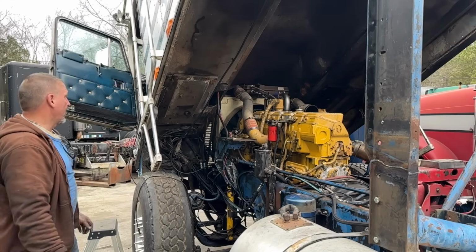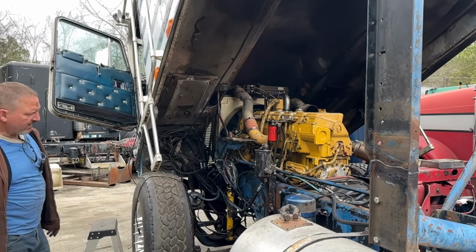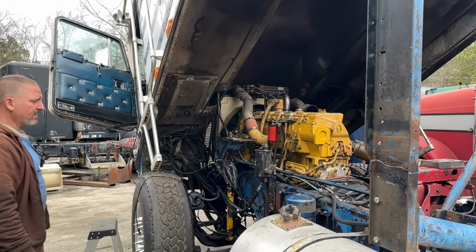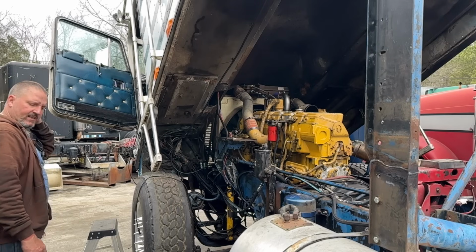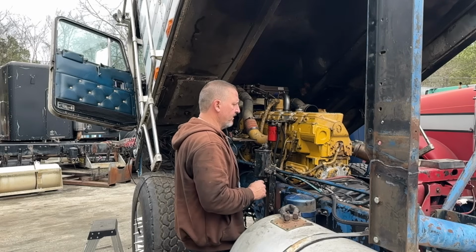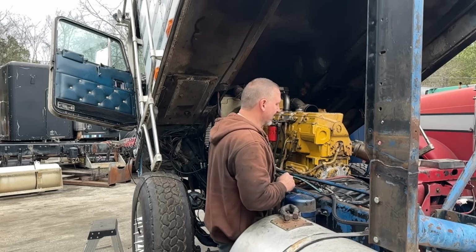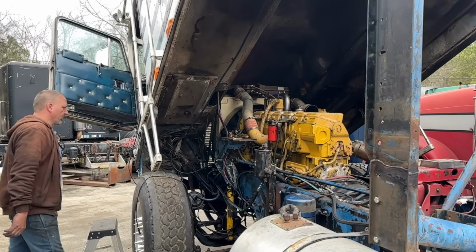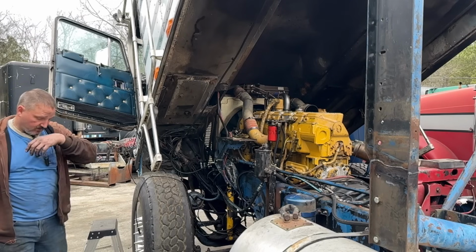And I'll just cap those off, because why mess around with that? I have a sensor in there. I can run that down there, put the wiring on, and bing bang boom, Bob's your uncle, and tach's working, right? And same with the speedo. I don't need to see the computer speedometer input, but the computer may need to see the input. But as far as tach goes, that's not a thing. So, yeah, I don't know. I'll be back.